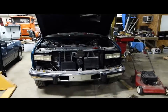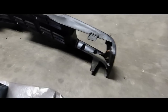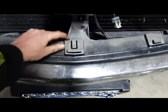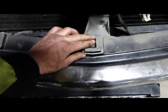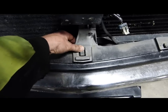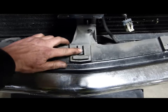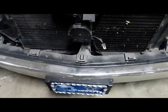The base model grille came out in much the same way, but there are two additional screws which secure the legs, right and left. And one more thing I didn't notice on the other grille: there's a central plastic latching mechanism at the base of the grille. Both grilles have them, but this did not hold me up — it just wasn't latched on the fancy upmarket grille. On this one it was firmly latched; just push down real hard and the grille should pop out.